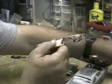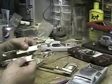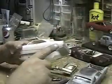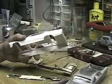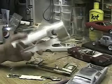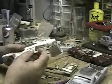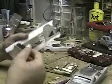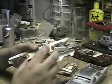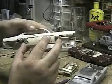But I have both pieces out. I'm going to clean them up and then go from there. Now when I cut the quarters out of the 66, I'm going to go ahead and save them, because you never know when you're going to need a wheel well opening or something else. Maybe it'll be close, it'll fit, so I won't throw that out, I'll just hang on to it. But the plan is to put this on here. Let's get the taillight, just flip it around, we'll show this side. We cut that right at the belt line, and then this piece will slide up into place like so.